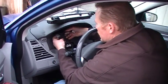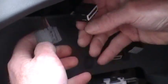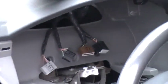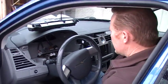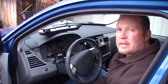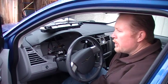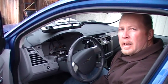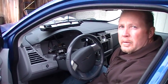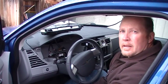As you can see, the connectors are right here. All the release tabs are on the top — just push down with your finger on the release tabs to unlock it and get it out of the cluster. There are four total. The installation is the reverse order of removal. If you have any questions or would like to send yours in for repair, visit us at clusterfix.com or give us a call at 509-366-9009. On the website, click the repair order form tab at the top to enter your make and model and see all the Chrysler vehicles we repair for electroluminescence as well as other models.